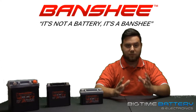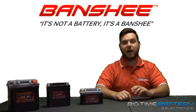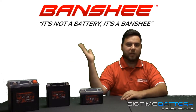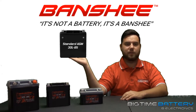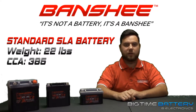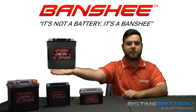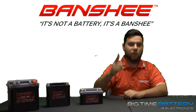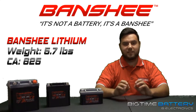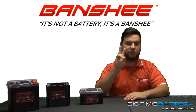Not only is the cranking power absolutely insane, the weight of these lithium-ion batteries is next to nothing — something close to an 80% decrease compared to the conventional counterpart. Here you will see the standard YTX 30L-BS battery: weight 22 pounds, CCA rating 385, warranty good for one year. Now the all-new lithium YTX 30L-BS by Banshee: weight 5.7 pounds — 16 pounds lighter — CCA rating 625, that's 240 more CCAs, and warranty good for two years.